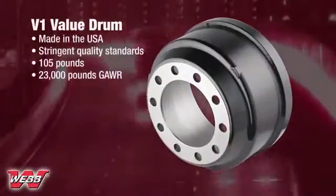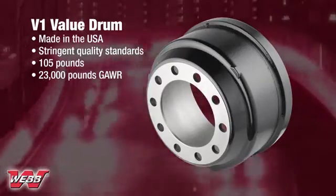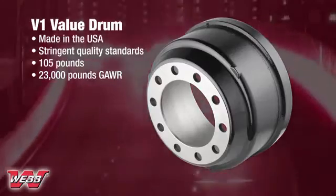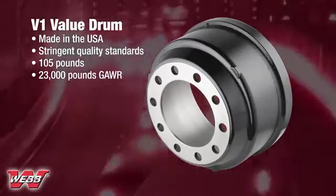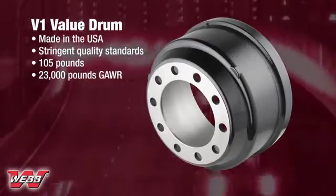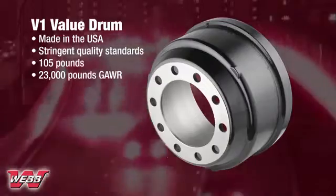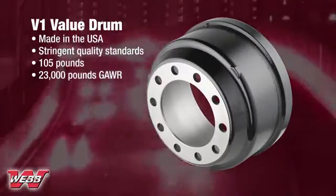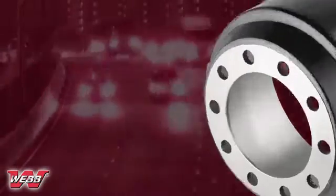The Value Drum is made in the USA to the same stringent quality standards as all Webb brake drums. It weighs 105 pounds and is recommended for standard duty, over-the-road, drive and trailer axle applications up to 23,000 pounds gross axle weight rating. If your application fits this criteria and you are looking for an economical drum, the Webb Value Drum is right for you. Dollar for dollar, it's the best value in the industry.